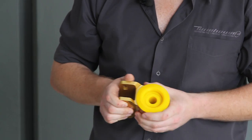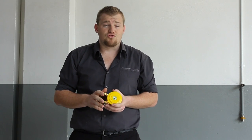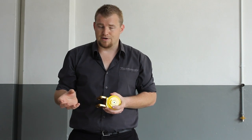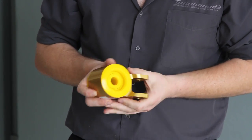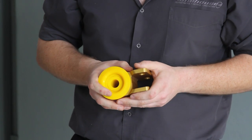Effectively, it's providing more weight over the front tires under acceleration. From a static and a dynamic point of view, there are some critical differences. When the car's sitting dead flat on flat ground, not driving, the static alignment setting improvement in caster and geometry is, say, one degree more caster. But the dynamic situation is actually quite more important because this bush allows less flex. You've got more dynamic caster above and beyond that static caster, which means when you're driving, the reduced flex in the bush means you've got a more significant and stable improvement in the geometry and alignment settings.